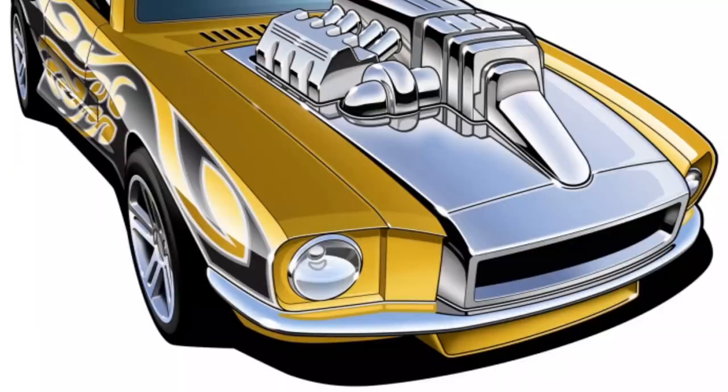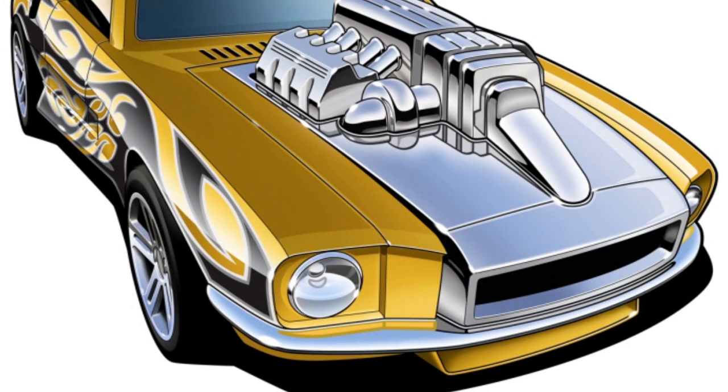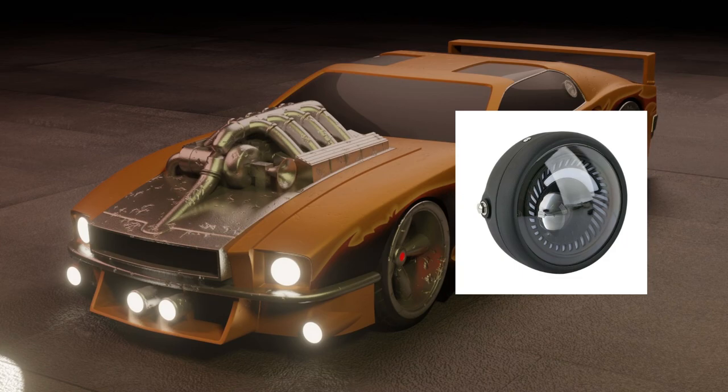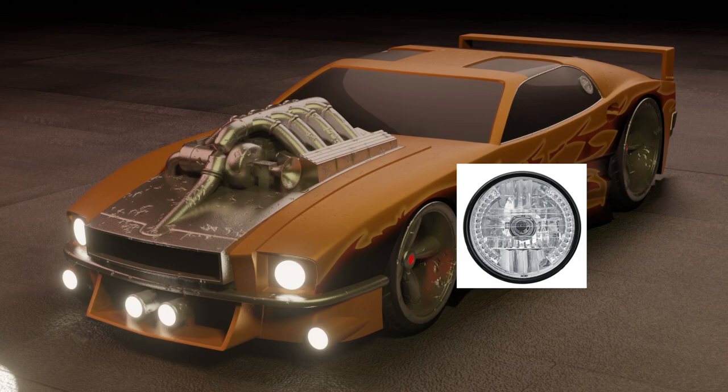Also in the front, you'll notice that there are more lights on the front bumper. Here, you're going to have to cut some holes to make it work. I decided that motorcycle headlights will do perfectly in this instance. For the ones on the outside, I decided to go with the 6-inch spiral headlight from Cafe Racer, which goes for roughly $40 a piece. For the ones in the center, I decided to go with the Banggood 7-inch motorcycle headlights for roughly $30 a piece.